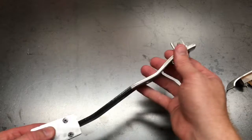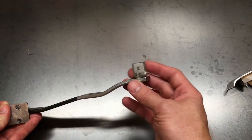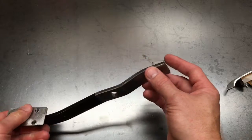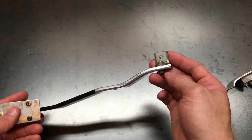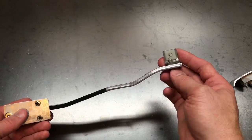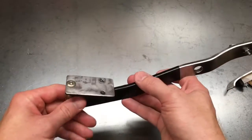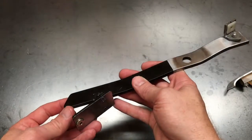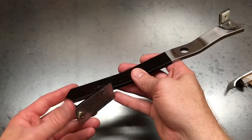A couple of obstacles I ran into right away: at the top where I attached to the throttle cable, it was actually catching on the foot box, which is a big problem. You don't want to pin your throttle and end up with a wide open throttle situation where it's stuck. And secondly, even though I had the clearance, I did not have the pedal angle that was ideal for my foot, so you end up pushing on it at a funny angle.